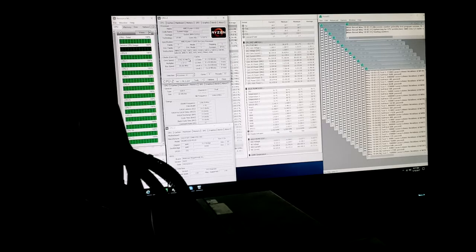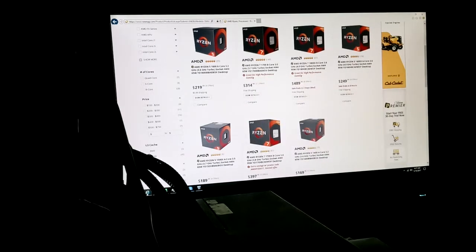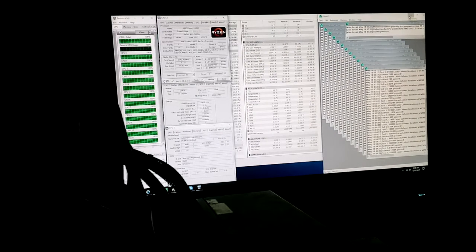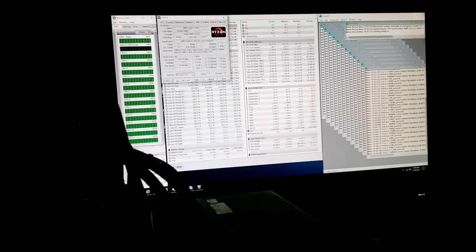I don't think it's a stellar sample, so you'll probably see similar results in the real world if you just go buy a chip and play the silicon lottery. It's only 50 megahertz lower than what I was getting on my 1600x — so is it worth the extra $30 for 50 megahertz? You be the judge. I like this chip; I like any chip I can overclock. I took a 3.2GHz chip and got 550 megahertz out of it — who can complain? Let's do some scores and show the variance from overclock to stock, just like we did for the other chip.